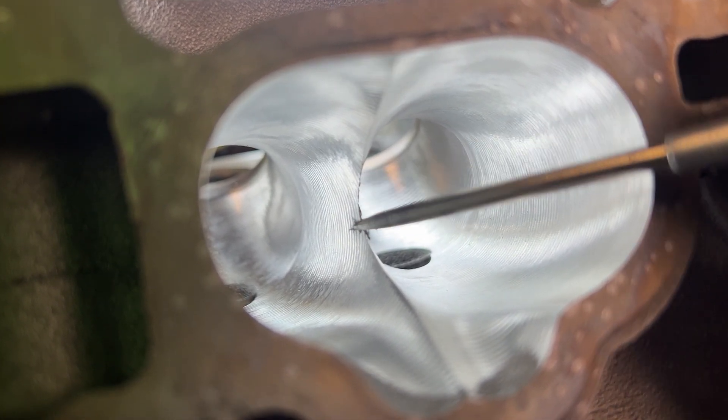We need to redo the intake because of this sharp divider. I see a lot of guys doing it and it's wrong. If they owned a flow bench and used it, they would realize there are actually gains in CFM from blunting that. It's a sharp edge from top to bottom and it's all in the way we clayed the port. We're going to clay it differently to get rid of that sharp edge, because the sharp edge can cause the head to crack if you run a lot of boost. We see cars run 100 pounds of boost through this type of cylinder head and it will definitely crack the divider. So when heads come in from another shop, we just hand blend them — blunt them with the Head Games 3.8 carbide.